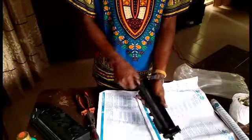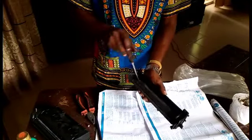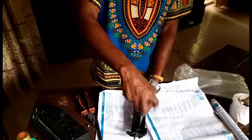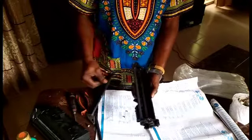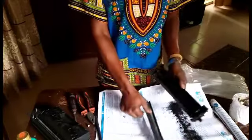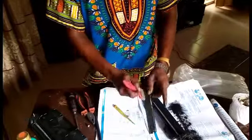You have to remove the corona. We want to remove the waste toner that is here — this is where the waste toner sits. Loosen the nose/clip that is holding the cleaning blade. If you check previous videos, we explain what the cleaning blade is and how to fix it if it gets damaged. Remove the waste toner, then use your brush to brush the cleaning blade and the blade area very well.